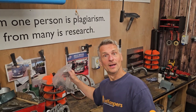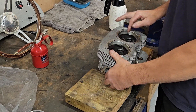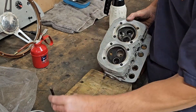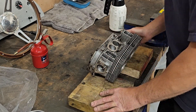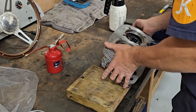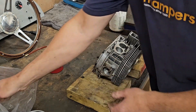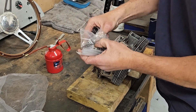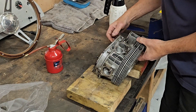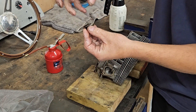Assembly time — not easy to show on camera but I'll see what I can do. We're going to put in the exhaust valve in cylinder number two. I've marked them one and two so I don't get them confused, and all the valves that correspond are marked as well, which makes life a lot easier. A little bit of oil on the valve itself before it goes in. Slide them in, then take the springs — we've got a big one and a small one. The small one sits inside the large one, over the top of the valve.